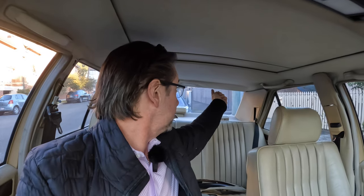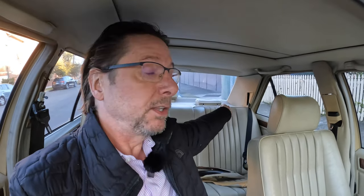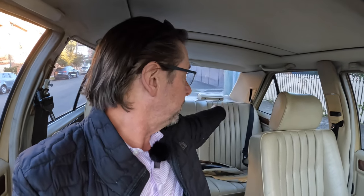We initially thought it might be just a cable or motor problem, because the way it works is there's a cable that goes all the way back through there, snakes around, down the C-pillar, into the boot where there is a motor. That motor pulls the cable backwards and forwards, and that basically slides the sunroof forwards and backwards. Essentially quite simple, but difficult to work on.